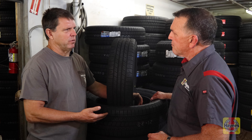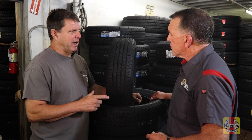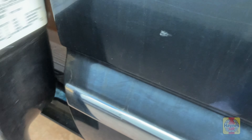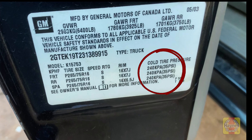So we do have a new tire here. One of the most important things is air pressure. Every car made right now has a placard inside the driver's side door. You can open it up and see what your cold tire pressure should be. Go by those numbers — it keeps your tire pressure sensors happy.